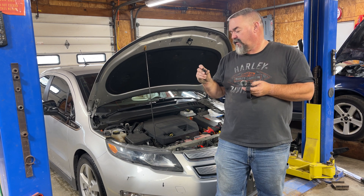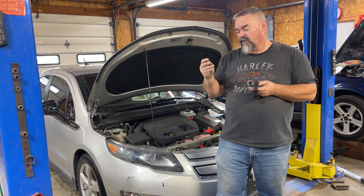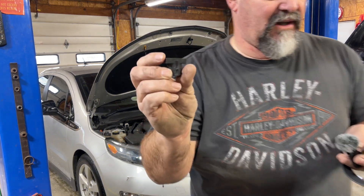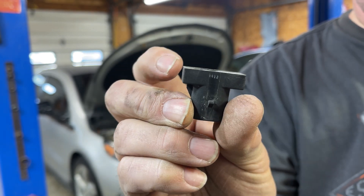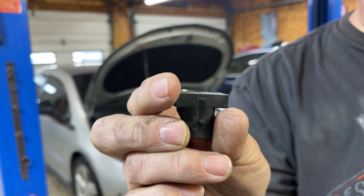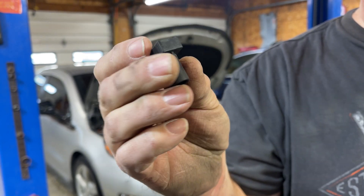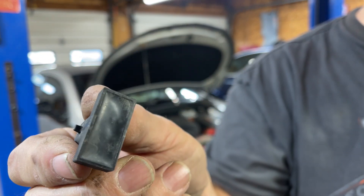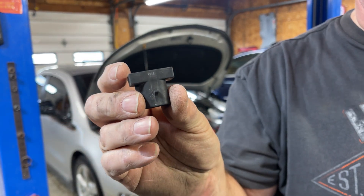I got the sensor out — it's a little bit of a task. One thing you need to know is the way this sensor is oriented: you'd want to put your hands on one side to get it out, but that side is blocked. You have to reach around the back where the radiator is and kind of pry it out, and then the sensor will pop out. This is the old one — a little dirty, it's got a hundred thousand miles on it.